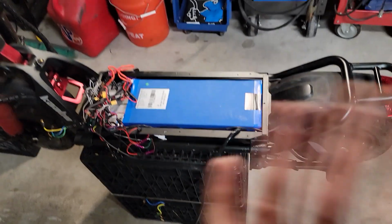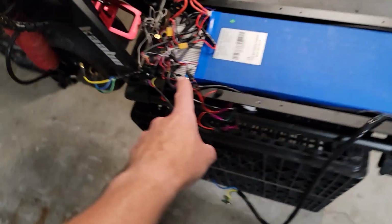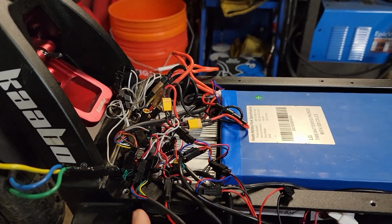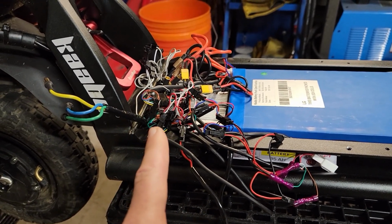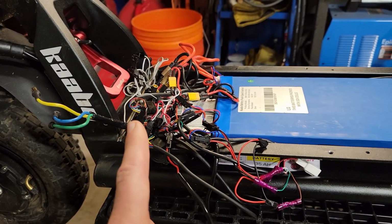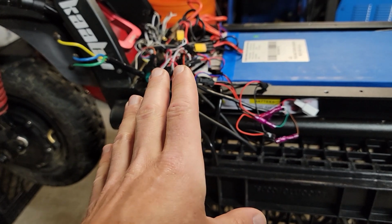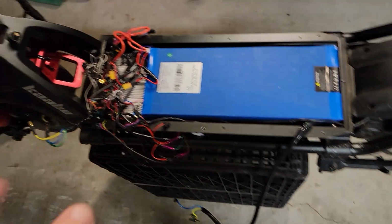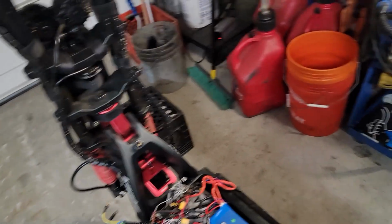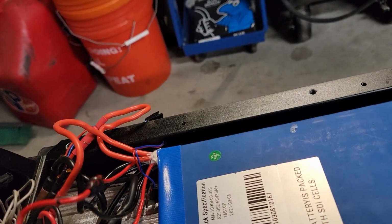So initially, when I took the deck lid off, the one thing that's always bothered me is this is the only area right here available for the wiring harnesses, and at best it might be an inch deep, and there are multiple wires just randomly shoved into here, and it's like somebody buttoned it down and said send her down the road. So there's no thought or rhyme or reason to any of this. I mean, it just doesn't make sense that they just shove everything in there. It's so unsafe. So I have a solution that'll be coming up in a future episode, hopefully, fingers crossed. But as far as what I found here is the simple fact that everything is getting pushed down and pinched so hard under the deck lid that you've got issues with wires rubbing on stuff.